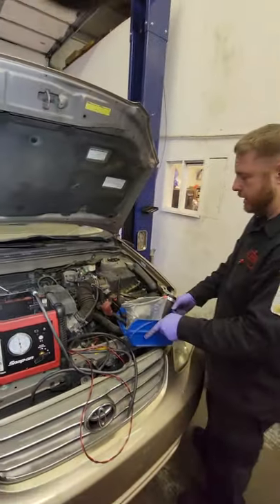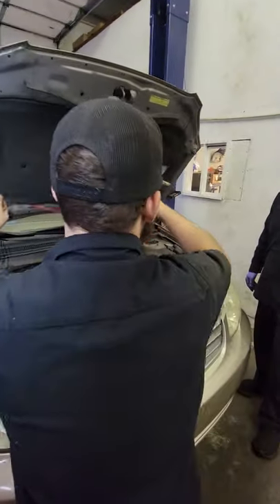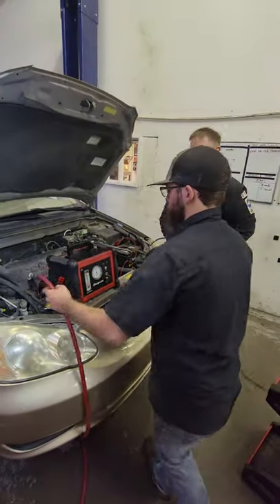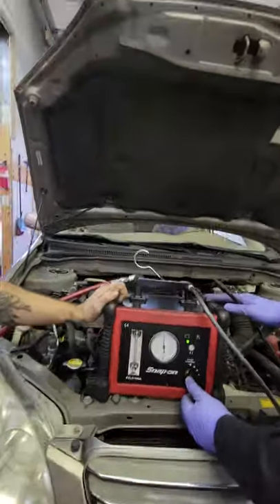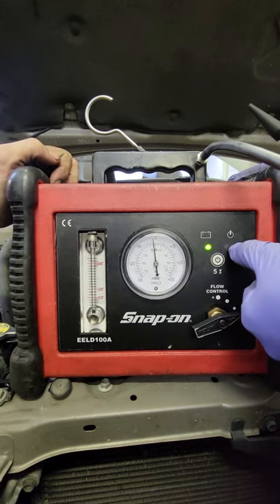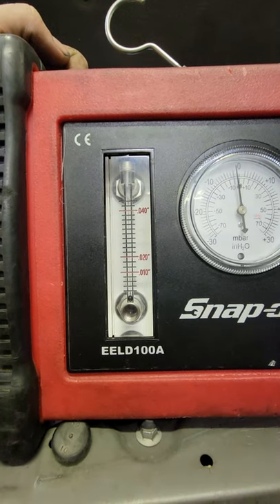Let's go ahead and hook up this machine. You need to get battery power and compressed air to it. This is your flow control — completely maxed out is one PSI and turned off is the other end; anything in the middle controls the gauge. This is your on/off button; if it's on, it will be red right here. And this is your gauge showing how much of a leak you have. When you first turn on the machine, it's going to be filling so it will show leaking, but after about 30 seconds it should settle. If it's not settling, you have a leak.